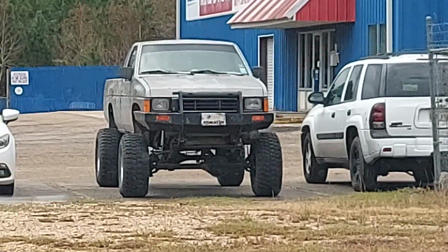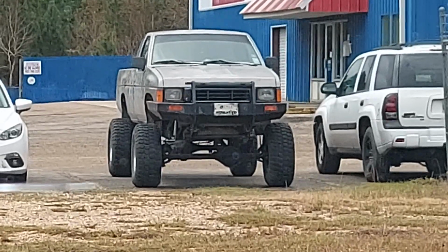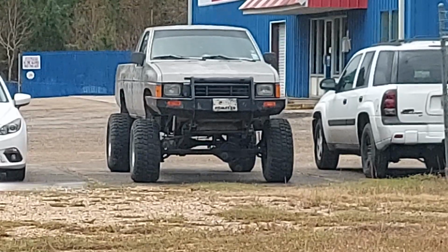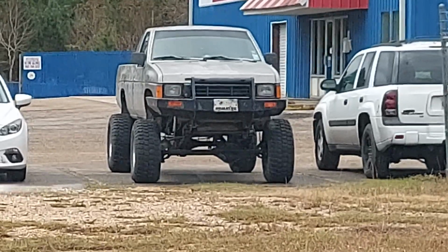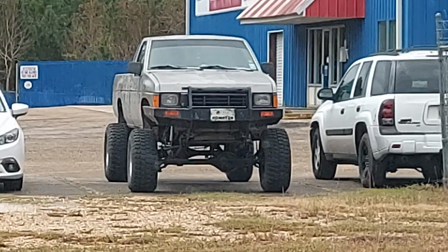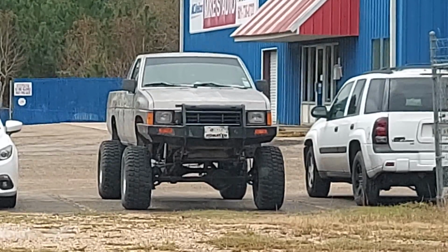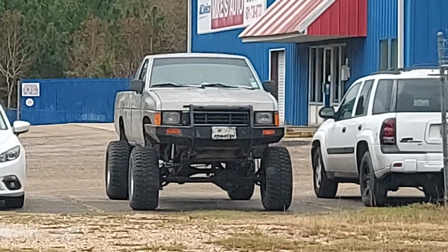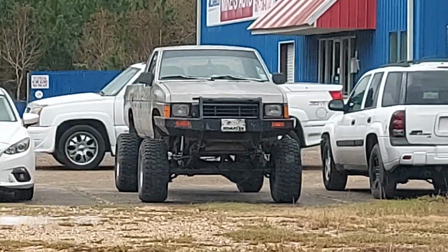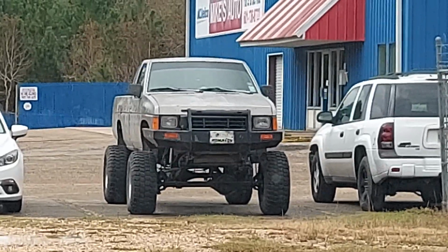What's going on, guys? This is a sequel to the video I made yesterday. I wasn't planning on making a second video, but I want to explain what happened. I made it 15 miles down the road in that Mack truck that I showed you in that video, and apparently the sensor was missing out of the transmission, and when the transmission would warm up, it would blow oil everywhere, all over my tow vehicle, all over the back end of the truck. I thought the rear tail housing gasket went out of it, but it wasn't.